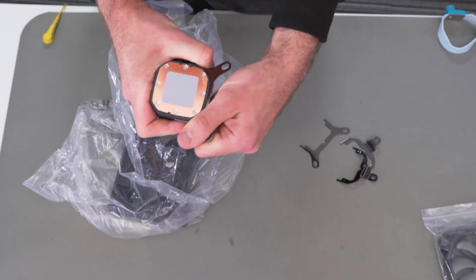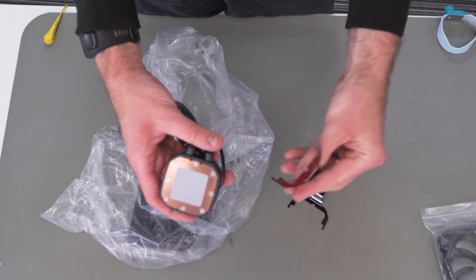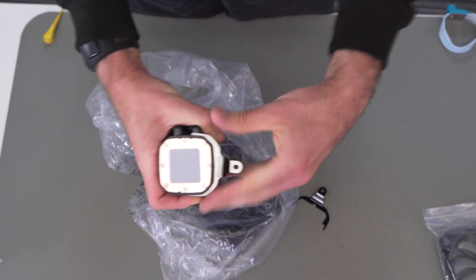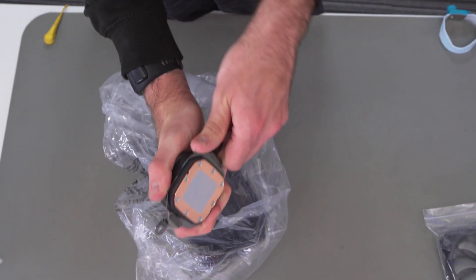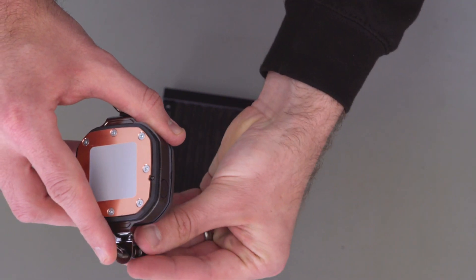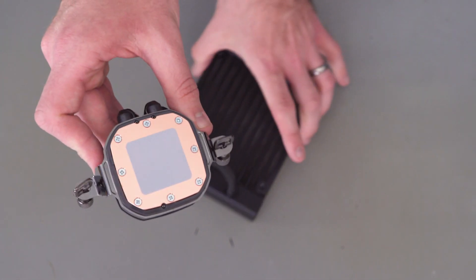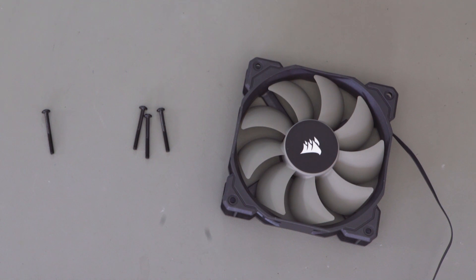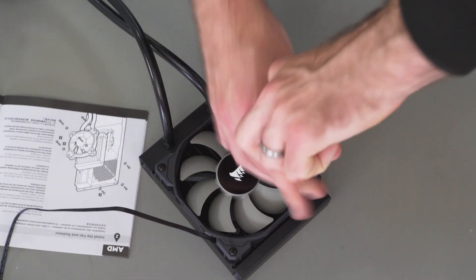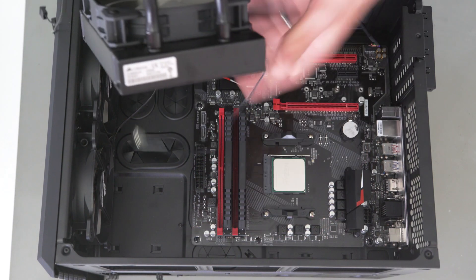Taking these brackets off can be tough — keep pulling, give them a bit of a wiggle, and they'll eventually give up their fight. Make sure the brackets are the right way around when slotting them in — you want them so that they stick up at the top of the cooler when screwing it down, and again they can be a bit tough to put on, but keep pushing. The locking nuts need to go through the bracket holes now — put the key side in through the bottom and the screw through the top, but don't fully tighten these yet as you'll need a bit of play in them to lock the heatsink down later on. Now we need to attach the fan to the radiator block — line up the holes in the fan with the block and then use the long screws provided. The cable for the radiator fan will plug into the CPU fan header on the mainboard.